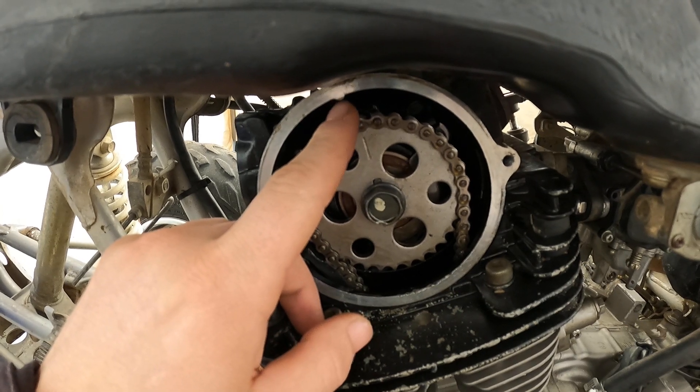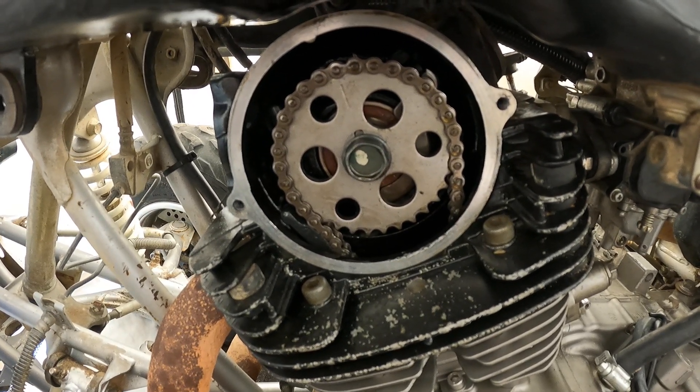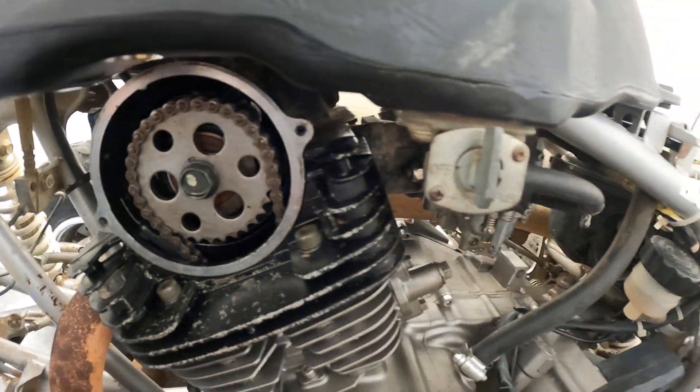If I put the F line in here it will match up perfectly, but I cannot get it to match up. I can't get it to start — just a little puff here and there. The carburetor is in great shape, but I just can't get this thing to turn over, and I'm very sure those marks are supposed to line up exactly.